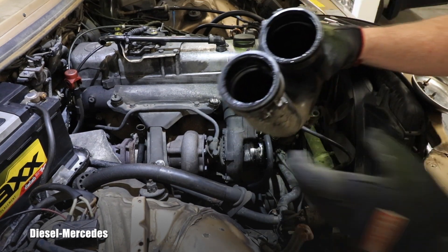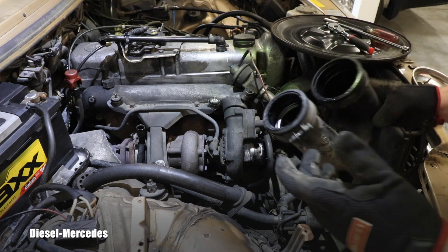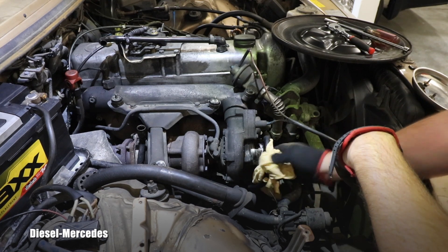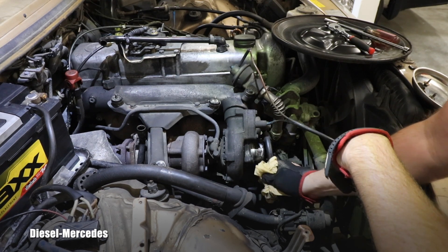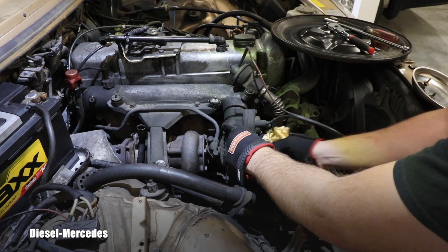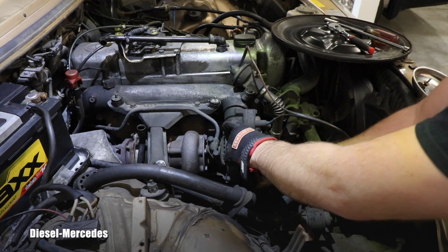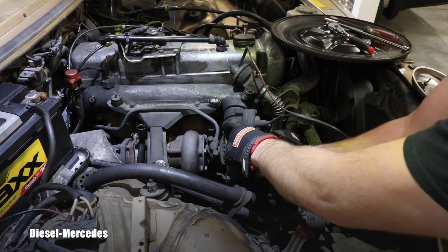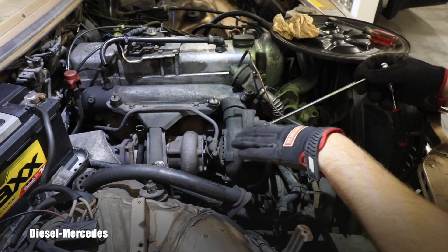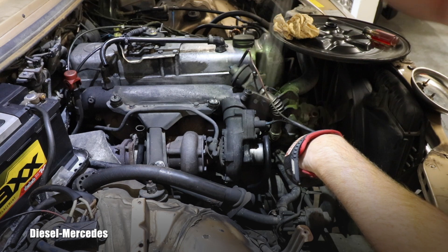Here we go, that should already give up. We can see inside — so there was completely false air coming in. Unfortunately, cleaning is extremely important around turbos, so immediately since I opened here the access to the front, I'm cleaning everything immediately. I don't want any dirt falling inside.